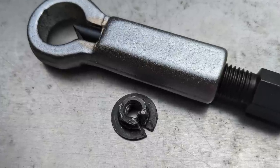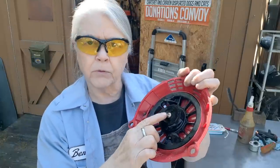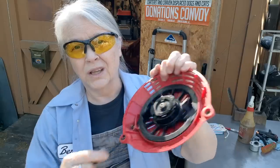After nearly two hours of trying to get this off, I just had to cut the nut off - it was kind of bad. I have replaced the recoil rope, and if you want to see a video of that I'll put a link there for how to do it on a Honda. One thing that's not in that video: if you need to replace the recoil spring inside, I put some drops of light oil in there. A lot of people don't realize this - the screw in the middle is a left-hand thread, which means clockwise is going to loosen it and anti-clockwise is going to tighten it down. A lot of people mess that up and it just goes into the plastic, so it's really easy to mess up. There we go - let's put this on and see if we can get this baby to fire off.